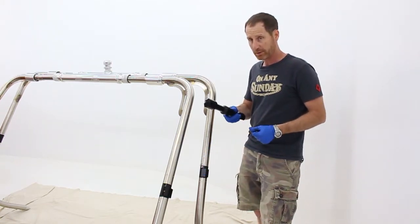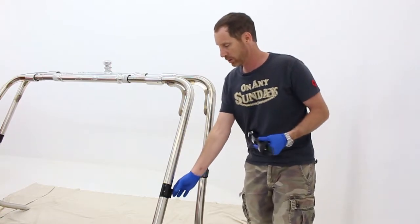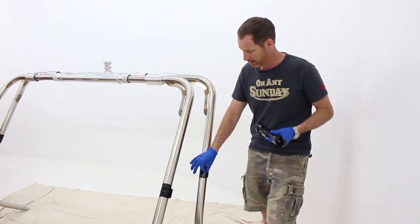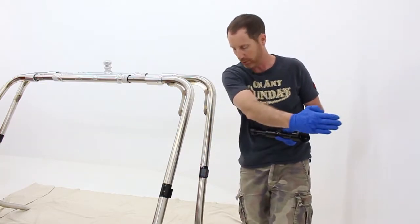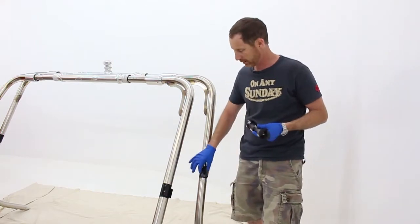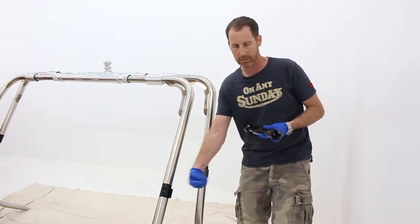I've got my strut assembly here, and we're going to show you how to orient it. Once again, our square shoulders, this point for the front should be pointing right at me, and this point here should be pointing diagonally over here. So they always point towards the inside and out. That's how you always know if you have it right. And the bolt hole should be right there facing outward.